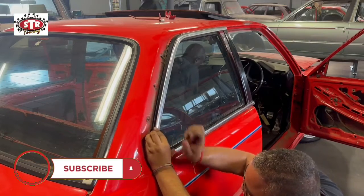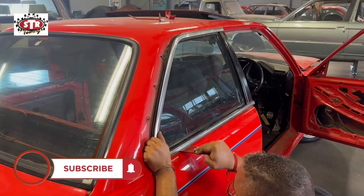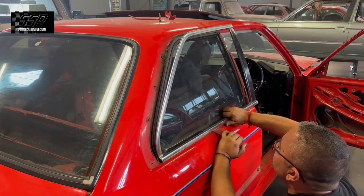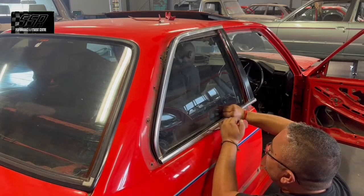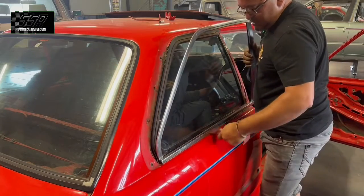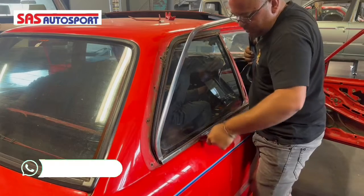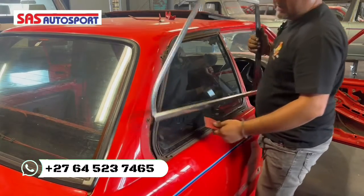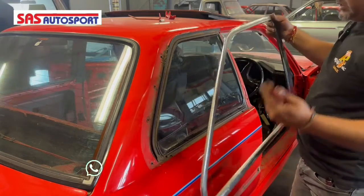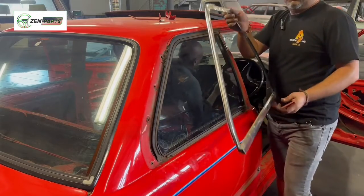Okay, so it looks like this. I don't know if it's a sealer here or what it is. Right, and it's stuck in the rubber. So let me see if I can slide it out here. It looks like if I lift up, I'm able to squeeze at the bottom here and pull it past the rubber. Okay, there it is out. Future, this tool worked better. This tool worked nice. So I managed to pull it out without warping any of the beadings.